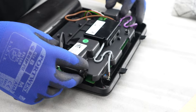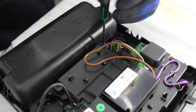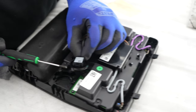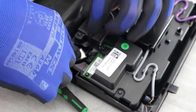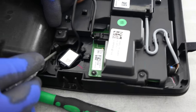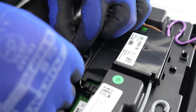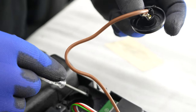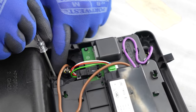When placing that down, just make sure the wires are not kinked — obviously you don't want to tighten down the screws with any wires underneath the unit. Now it's all done. Reinstall the speakers — there is actually a point that shows where these need to go into the new unit, showing you the correct direction to put the speaker in. Make sure all the retaining clips are in, put the wire back on, then reinstall the speaker on the other side again using the guide shown to make sure it's in correctly. Check all retainers are holding it in properly and reinstall that wire again.